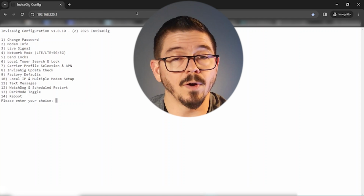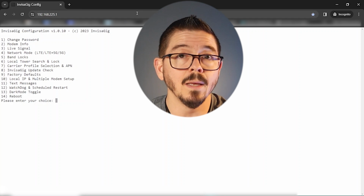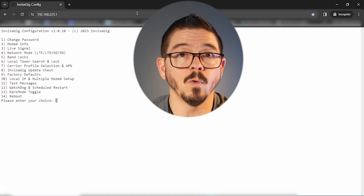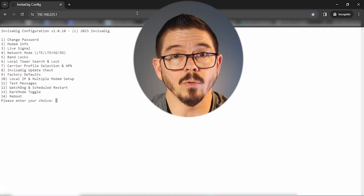192.168.225.1. It's very common. A few that we've tested have done this automatically. There's no need to do anything. You're just connected online. Others require specific settings before the network will allow you to attach and transmit data. So we're going to go through those steps.